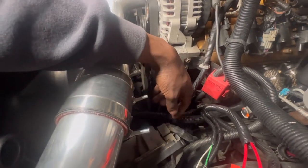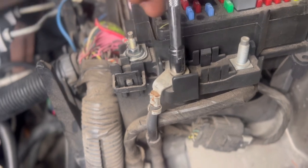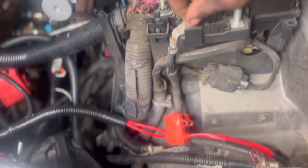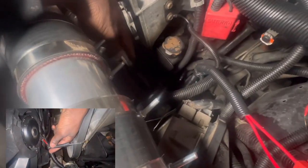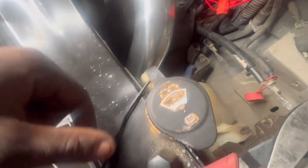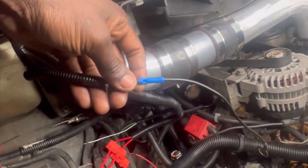We're going to see what's under here. I got my screw on this little part right here — I think it's a 7mm, yeah it is. This is from this box here. You could plug it up there, but I think it's going to look better plugged up over here. This wiring harness from Amazon — I do have to extend this one particular ground. I just grabbed another pigtail from my light bar since I was never using it. So we're going to end up hooking that together. Wire is done right here. I'm going to throw some heat shrink over it and go from there.